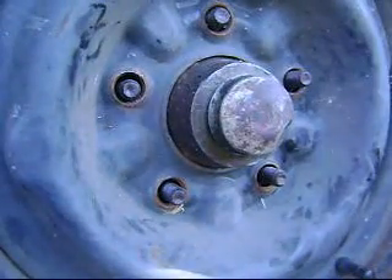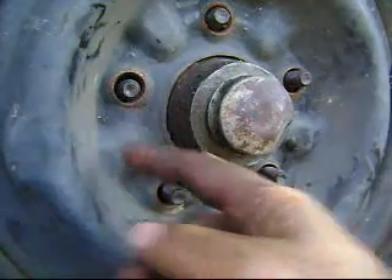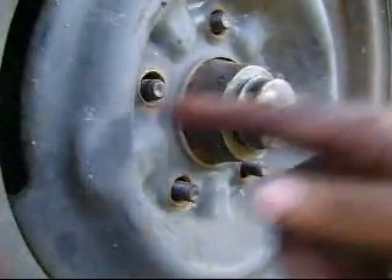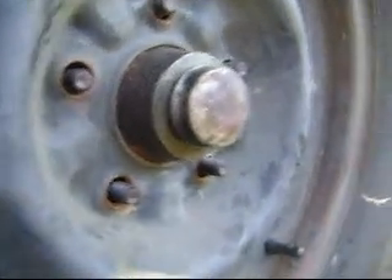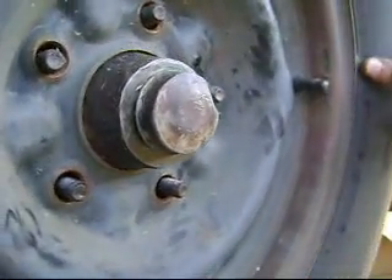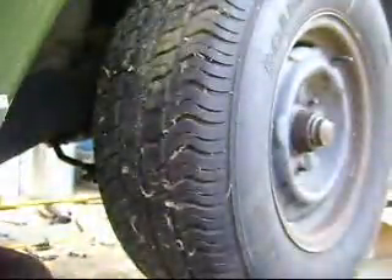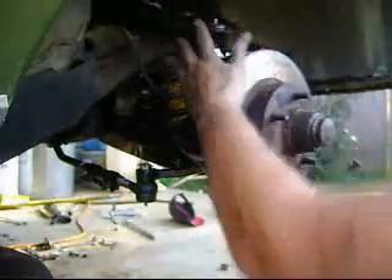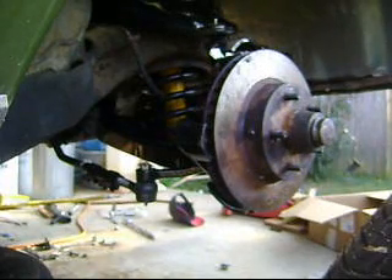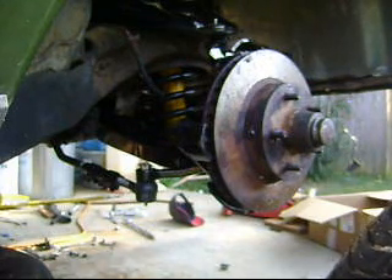Of course, it's always something. I don't think I'm clearing my caliper. Notice how little space I have on this lug nut — it just barely comes out over the lip of the rim. Whereas on these, I've got plenty of space. Look, it comes out. What that tells me is that I'm not clearing my caliper right here. I can't put these wheels on. I've got to get new rims before I can put wheels on this car and get it out of mom's carport. To be continued.